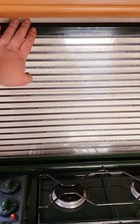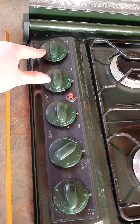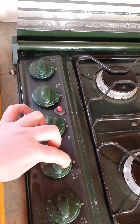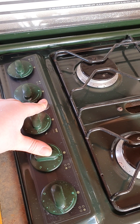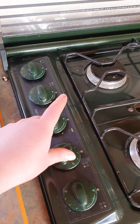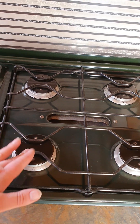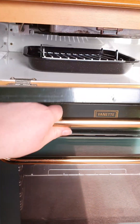Just below your RCDs is your oven top — pop that glass all the way back and you've got four gas elements. The controls are along the side: two elements, then two elements, and the control in the middle is for your grill on the front of the oven. Much like a barbecue, push and hold the dial, turn it to the highest flame, then press and hold the igniter. Once it's lit, you can release the igniter and button, then adjust your temperature. Back to the circle for off — that's the same for all five controls. Once you've finished using the elements, make sure they and all the surrounding area are cool to the touch before popping the glass lid down, as it can shatter if they're still hot.